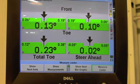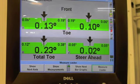So now let me show you what I was under there adjusting. Hopefully we can see it. Okay, here's the lower control arm on this car. It's not V-shaped, it just has one point right here to mount it. And then they have what they call, it's hard to see with this camera, a strut rod going back. So if you look at it like this, the more I lengthen this rod, the more the lower control arm goes forward, the more positive caster I'll get.